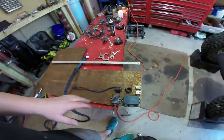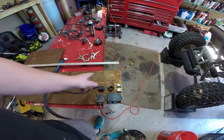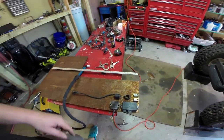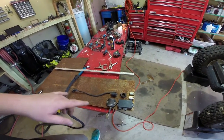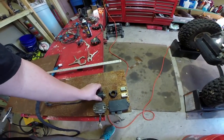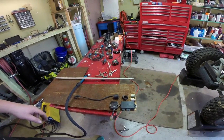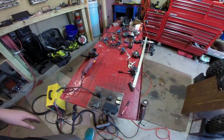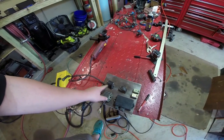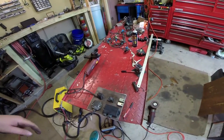Next thing we're going to do is mount all of our electronics. This actually fits in here, but we're going to make it a little bigger to fit that space — eight and a half inches by ten and a half inches. I'll plasma cut what we need, then we're going to rivnut everything in. We'll need a little spacer for the coil because it's got to sit up. There's our electronics layout board: we've got the ECU, regulator rectifier, ignition coil, starter module which will mount in here, and our two relays.